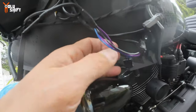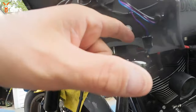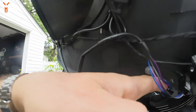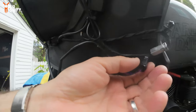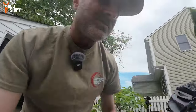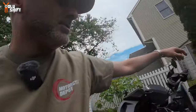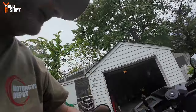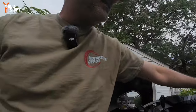You've got a cable to plug in place. I disconnected one of the wires going to the stock signal light, connected one side that fits on the plug, then connected back to the rest. It's so simple — you tap into the line, disconnect it, one side goes in, the other side goes out, and in the middle you have your new device. Test it before you close up — and there you see, it's running. I'll do the other side.